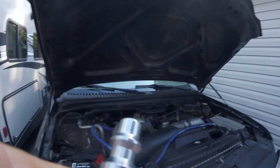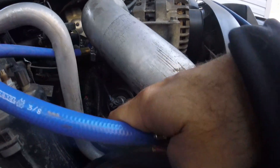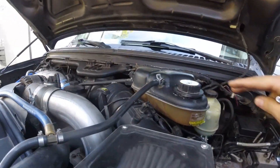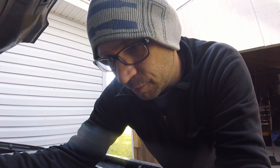We're going to run a few tests. We're gonna check — they call them fuel rails but they actually contain oil. This adapter goes behind the ICP sensor right there on the passenger side. You put that in, connect air to it, then you open your oil fill cap and listen through the crankcase ventilation hole for leaks. First things first is to do the ICP sensor air test.